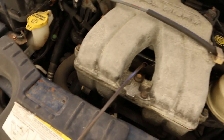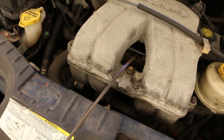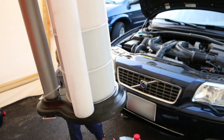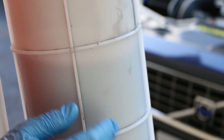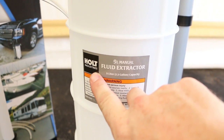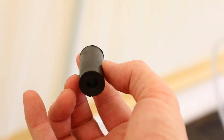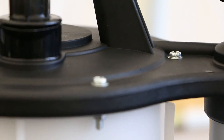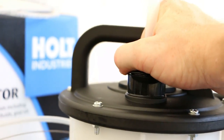Pros and cons. Pro: you don't have to take off your drain plug if you're doing an oil change. Pro: it's pretty easy to use because you just pump and the oil comes out. Pro: it can hold 2.3 gallons of fluid, so for most of the engines I work on they don't have that kind of oil capacity and it can work in one shot — with my motorhome, the Cummins ISB300, I just had to empty it once in the middle. Pro: it's got solid construction, pretty well built, doesn't feel flimsy, like it could drop and still stay together. It doesn't feel like your normal Harbor Freight cheap tool — I think there's a reason why it's $90 and they don't let certain coupons take the price off, because it's pretty decent quality.